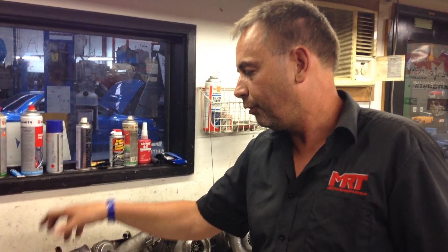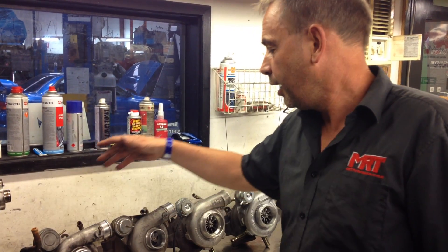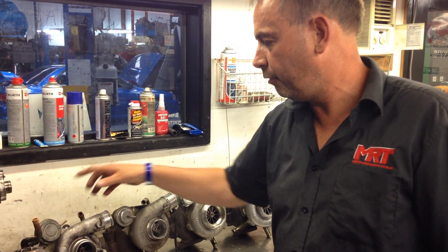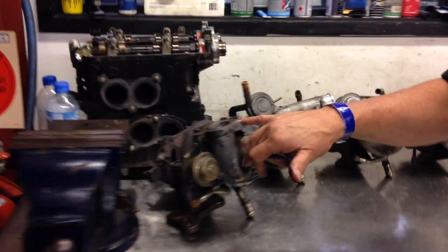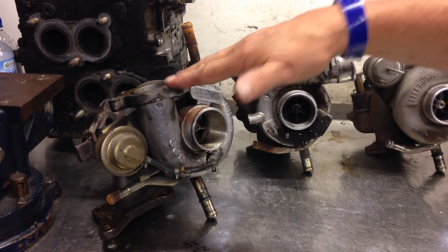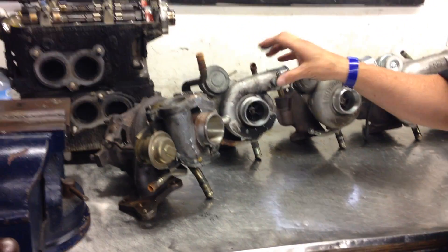The TD04 was a bush turbo. This turbo was effectively almost the same turbo from 1994 right up to 2008 on WRX's, which was then replaced with a VF52 turbo. Subaru changed the position of the inlet manifold design and the way the intercooler fitted - it was very similar housing to the TD04 but with a rotated front housing and a flange with a connection that bolted on and connected to the intercooler. That was the replacement to the TD04, which the MY09 got as a much better turbo, right up to the final model MY13/MY14 Subaru WRX.